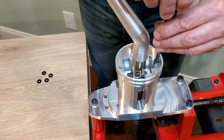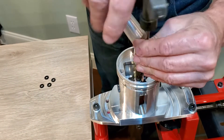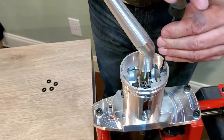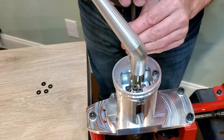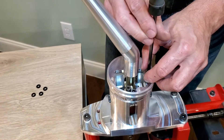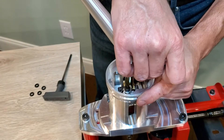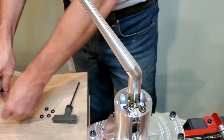There is some spring tension on them, so do a few turns at a time on each screw. Move each of those carefully — being careful not to drop it down in the shifter — and then that top cover slides up.